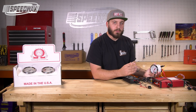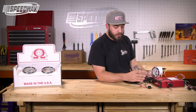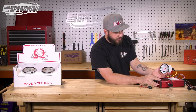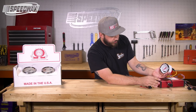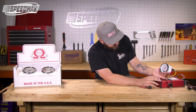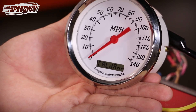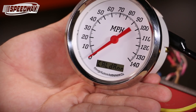Now with these units you actually have to start with the gauge off and no power running to them. You'll want to hold in the push-button and then turn it on. Once you do that it'll go to a setup menu, very much like our hello menu from the last video. You'll cycle it through until you get to a page that shows C-A-L-D-A, which looks like N-N.